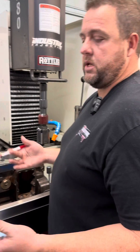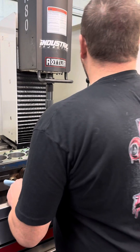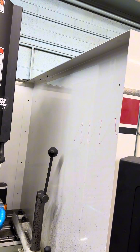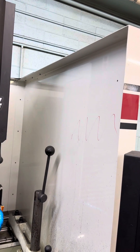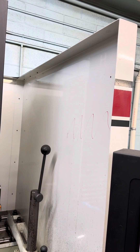What's the difference between a bore surface and a hone surface? Why can't we just bore it, put pistons in it, and run it? Well, the issue is this: under a microscope, that is what the surface looks like — it's torn, it's ripped out of there on a bore. This is your surface. So what we do is we take that and we need to get it back down to base metal. We've got what's called peaks and valleys.